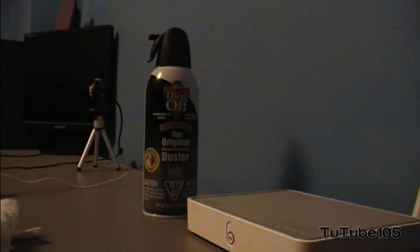The third thing is that when you spray at your PC or any portion of your PC, make sure you are at least about 4 inches away from the object you're spraying at. This is because the gas could freeze your object, and it is quite pressurized and could dismantle your component. So there are a few extra points — thank you guys for watching this video. Peace.